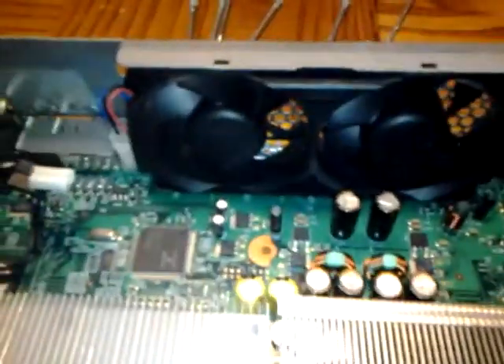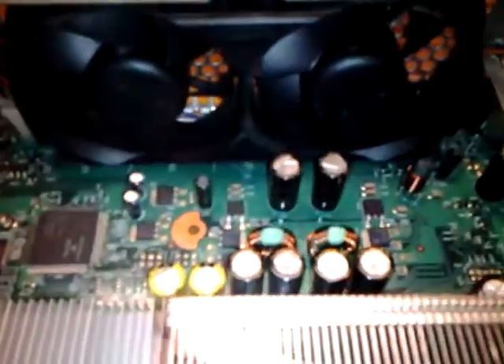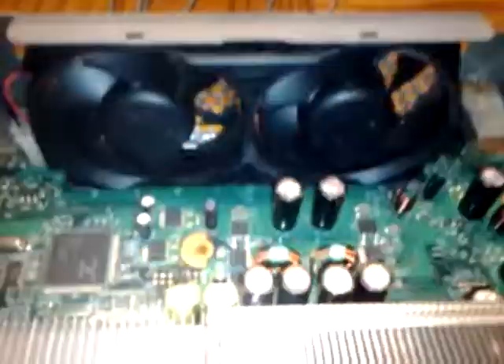They don't cause many problems on your board from the electricity generated by these magnets, but just brush and get all your debris and dust out of your heat sinks. If you have a bunch of debris globbed up in there and you really can't see through your heat sink, hit it with air — but just make sure you disconnect your fan first.